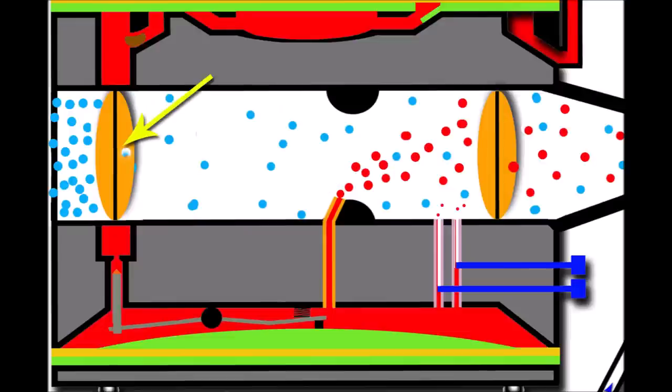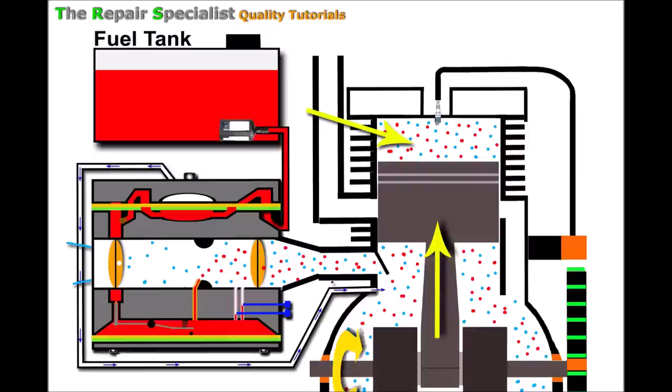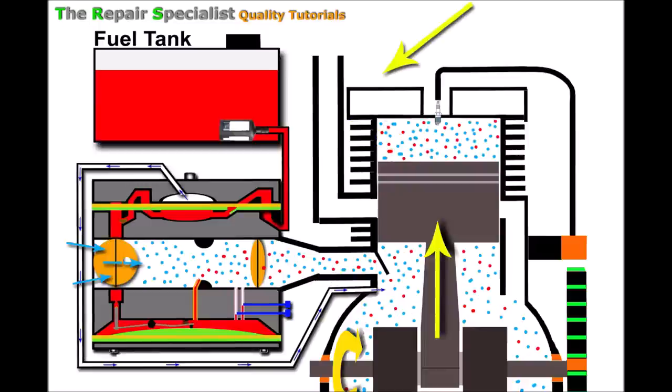When we activate the choke, we decrease air into the carburetor and increase the vacuum, but that vacuum is unlikely to draw more fuel out of the little fuel holes because of how the screws are set. Instead, the vacuum affects the main jet and draws more fuel out of it — that's why applying the choke might seem to get the engine running a little better when mixture screws are set too lean. But as always, this is not the answer — the answer is to get the carburetor set up properly with correct mixture screw settings.